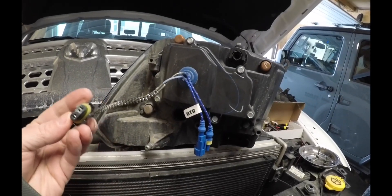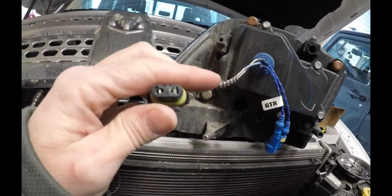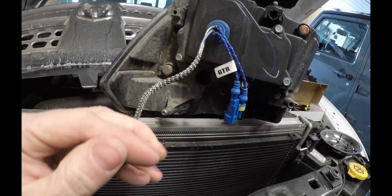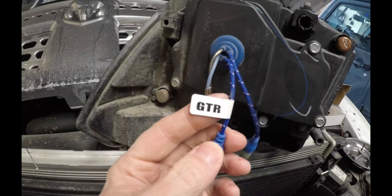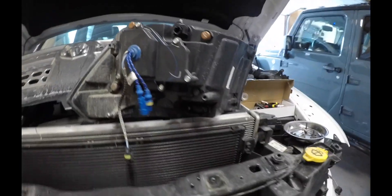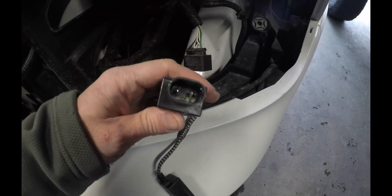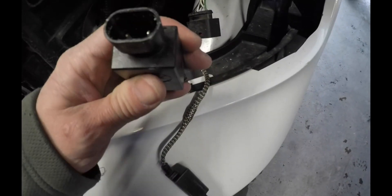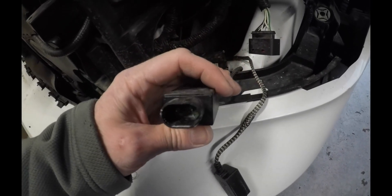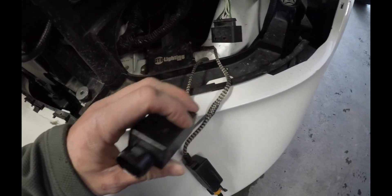As you can see, we got the light out here. Something a little interesting — there looks like there might be a little bit of corrosion in there. I don't know if that had something to do with it, which possibly could. Maybe get some dielectric grease on there and see if that cleans it up. It is a GTR light, but we'll have to get this off. Looking at this connector, it does look corroded in there, so very possibly that is the case. What we're going to do is clean that out.